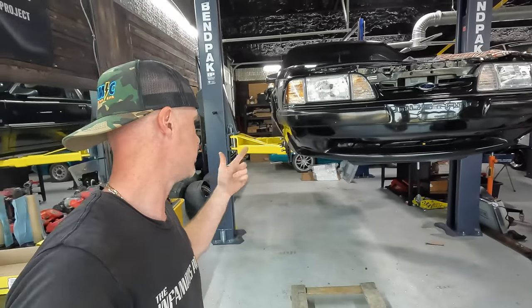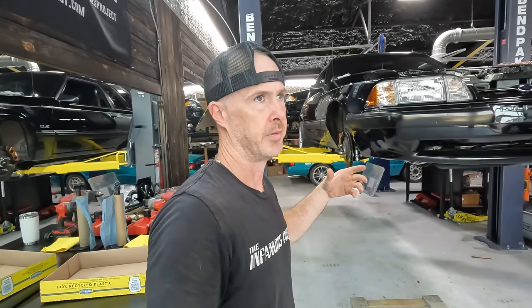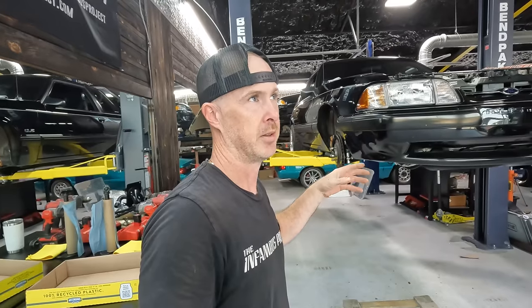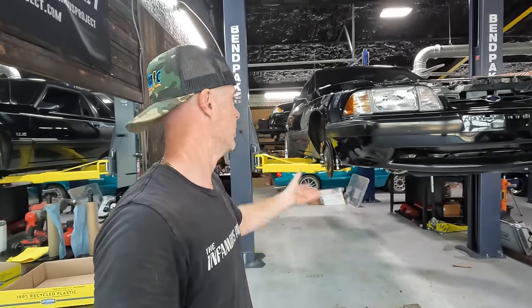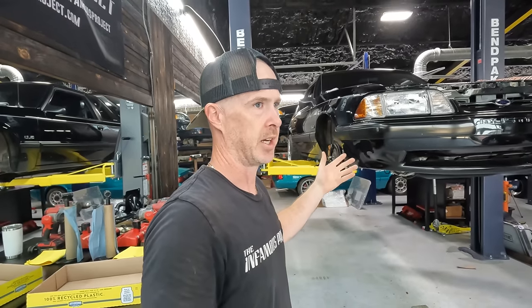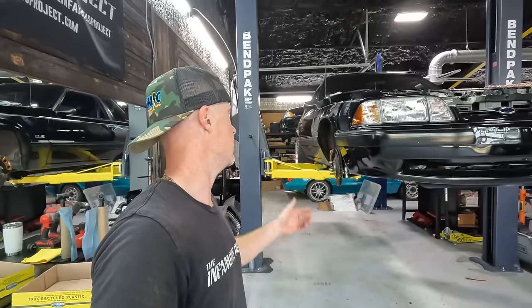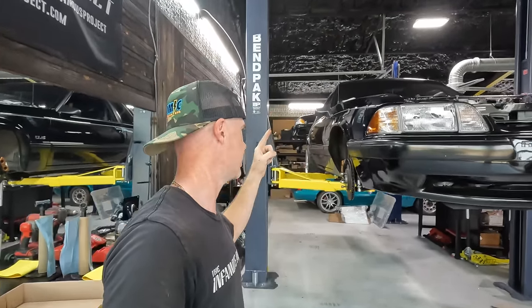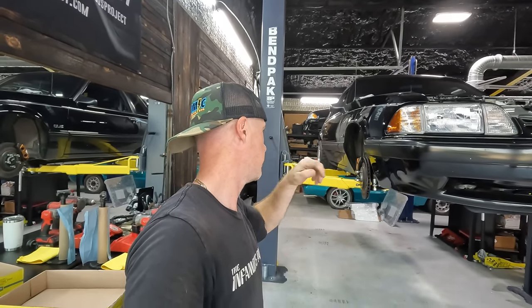I'm going to put the car up. We'll do the steering shaft, get that out of the way. There's 6 bolts holding the K-member in. I'll drop 4 out all the way up in the air, just enough to keep it in there. Undo the struts from the top, off the caster camber plates. I almost forgot about that. And in fact, maybe I'll undo all the K-member bolts.